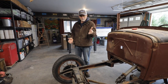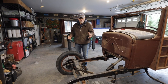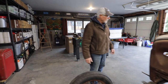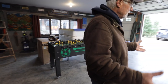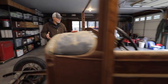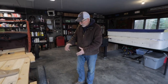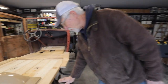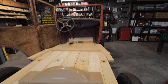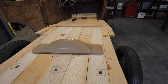We do have new tires with newly powder-coated rims, so they'll all go together really nicely. And then the rear end, we need to take that out as well and do the same thing — clean up the springs, the shackles, the bushings, and go through the rear end, make sure that's all working well, and again do the brakes and new tires and rims. So this is the new floor right here that came from Pleasantville, New York, and they built it as a kit, which really works out slick.